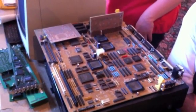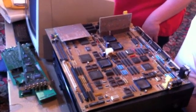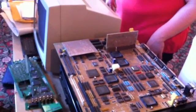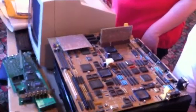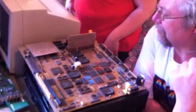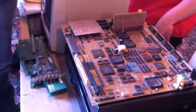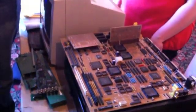They're just standard chips now. They pulled it — when this went, they pulled all the good chips off and used them on everything else. So anything that wasn't worth changing, they left. The old clocks are involved though. And that's the main difference about this to the normal Amigas — they've got loads of different clocks, all slightly offset, all the capabilities, so the data would have been ready on the bus as soon as it's needed.